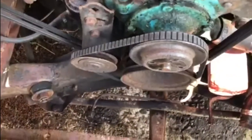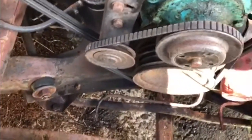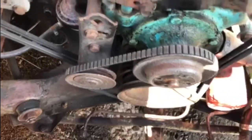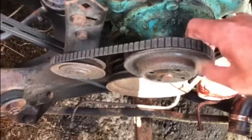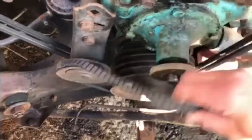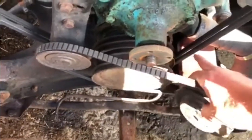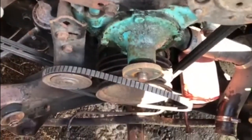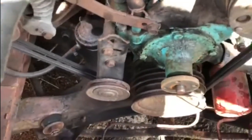As you can see, that's the radiator's out, the fan's off, the fan belt's next, then this pulley, and then we can get to the water pump. I think that pulley, we might be able to just slide that off. Will it slide off? Yes, it will. So we'll get that pulley out. Take that belt off, I'll adjust that later.